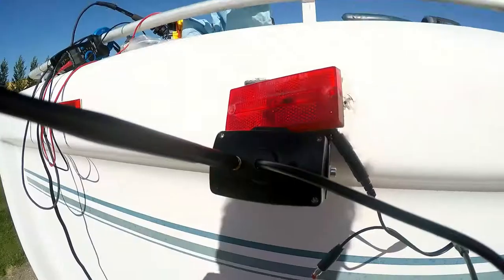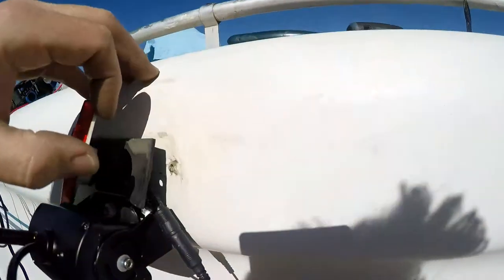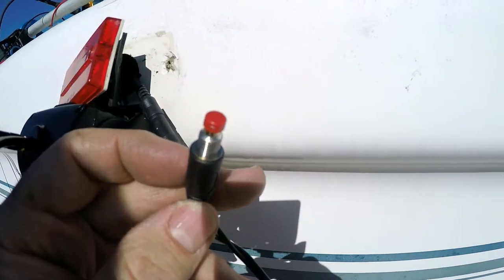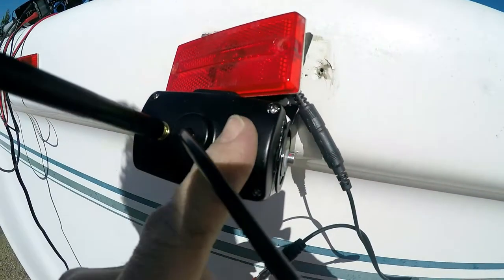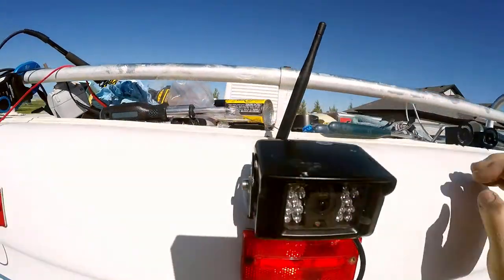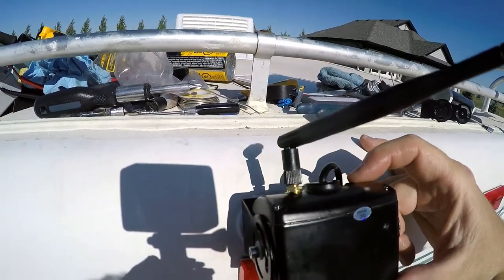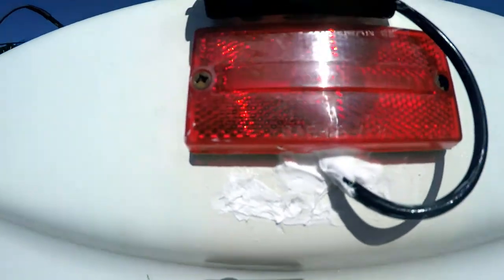Make sure you include your antenna. The camera is now mounted — time to tuck the power cable back into place, and I'll run some electrical tape around the two connections so they don't come undone. The red button is used to sync your camera, which I'll talk about later. It is waterproof, but I'm going to tuck it inside anyway so I don't want any water penetration. One note: the antenna comes out of the top, so you need to mount it high up on your trailer because it gets blocked otherwise. I had to remove and remount it, and I've resealed the area with silicone.